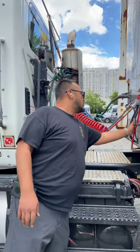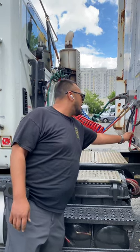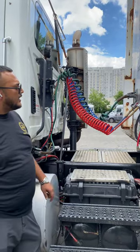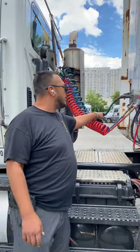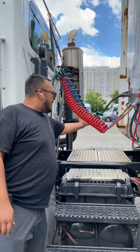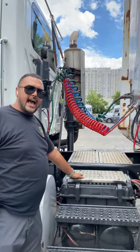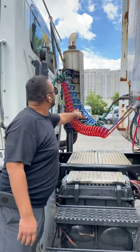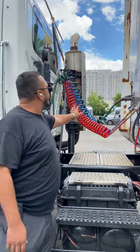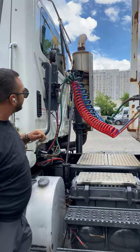All the airlines and electrical lines — airlines have no abrasion, no bulges, no cuts, no audible air leaks. The electrical lines have no abrasion, no bulges, no cuts, no sight or smell of any burns. My airlines and electrical lines have proper clearance from the catwalk and have extra length for turns. The spring hanger holding them up is not broken, not cracked, not damaged, and is properly mounted and secured.